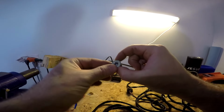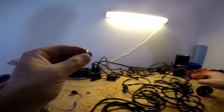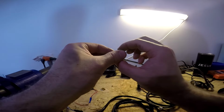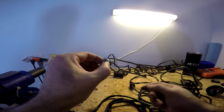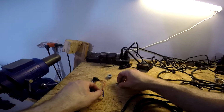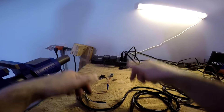You're also going to need one of these. This is a zinc plug that you can put in the bung in the exhaust when you don't have the O2 sensor in there, because you don't want a gaping hole in your exhaust if you remove that. So you need a plug to be able to put in the hole when you're not using the system. That unfortunately does not come with the kit, so you got to buy that separately as well. So you got to buy the plug separately, you got to buy the AFR circuit separately, and you got to buy a 5 amp fuse separately. And again, I'll put links to all of that in the description.